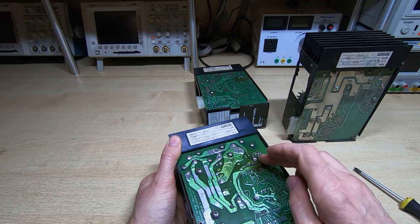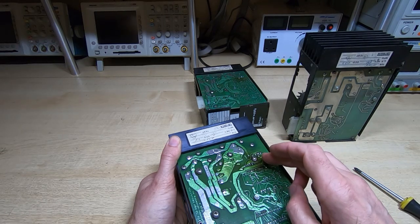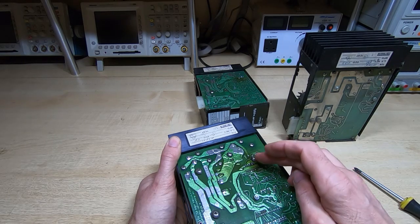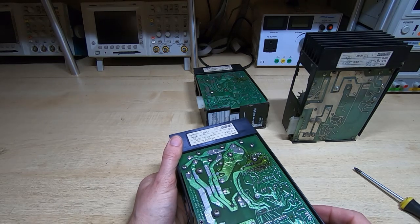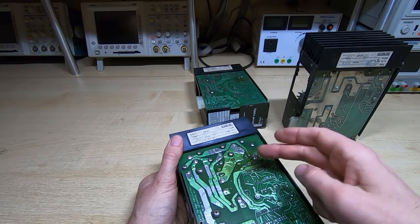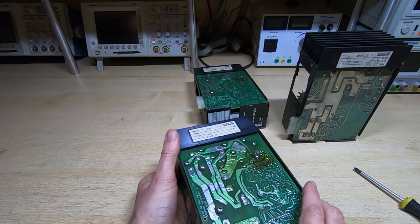I have done it on one previous machine and it brought the temperature down from a little over 80 degrees to just under 60. It's a very simple modification and it's not a one-way thing — it can be undone if ever the owner wants to go back to the original setup. It's just really taking the clamp that's on there and fitting a slightly bigger one.